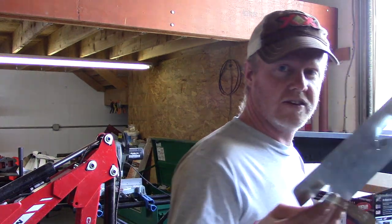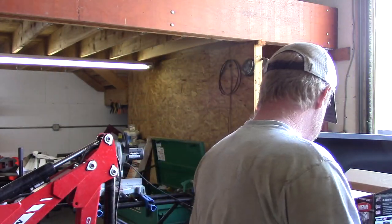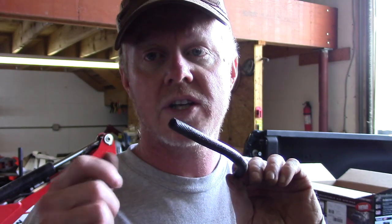And now we're going to install this where the air spring's closest to the exhaust, and this will provide a little bit of heat shielding for that. Be sure not to forget, I have not connected up the other side of the Schrader. When you cut your hose, I actually measured mine off to make sure they would all reach. Some people say cut it in half, but I don't recommend doing that.